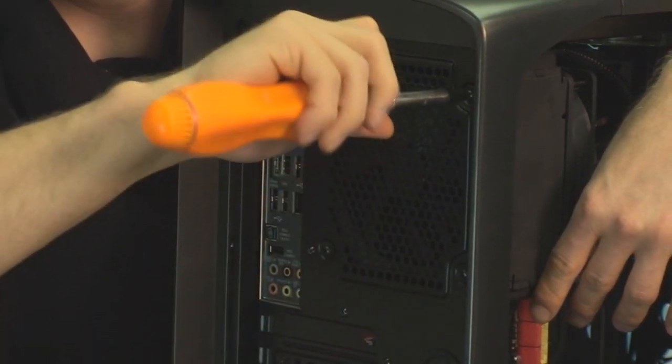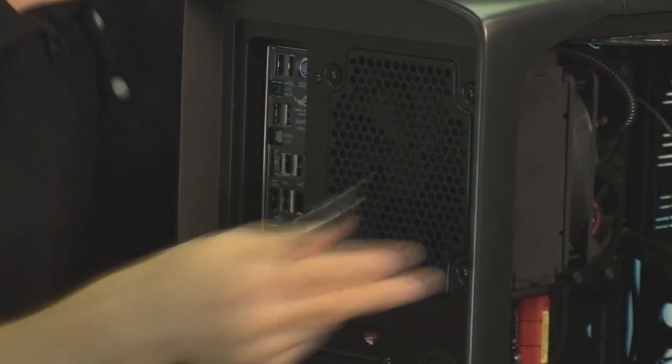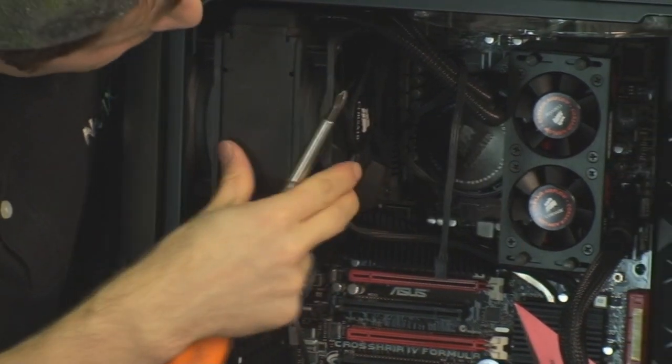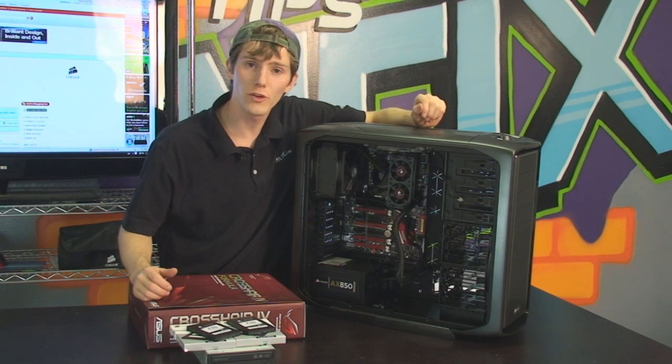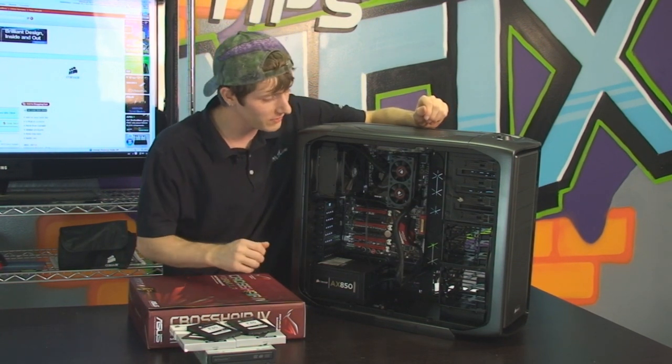And there we go. The H7T is installed in the 600T case as an intake, cooling off that 6-core turbo CPU. Next, we're going to do the positioning and installation of our drives. So we have our 2 SSD drives as well as our DVD drive.